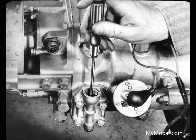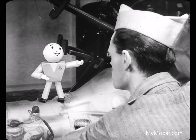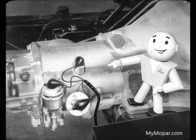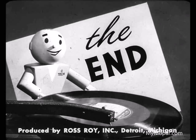But if you are getting current at the solenoid, then either it's gone bad and has to be replaced, or else the pilot valve needs freeing up—in that case, you'd want to check the main valve too. Now that you know how to check for no upshift, no downshift, and for immediate upshift, you should be of some real help around here. Diagnosing one of these transmission jobs isn't that easy, but it's not so tough either, if you just stop to figure out two things as far as the electrical system is concerned: whether the trouble is first because the current wouldn't turn on, or second because it wouldn't turn off. And believe me, the little time it takes to figure that out saves you plenty of time later and a lot of unnecessary replacements. There's no faster way to boost your stock with customers than to fix up a transmission in record time—and the secret of that is just know-how based on common sense.